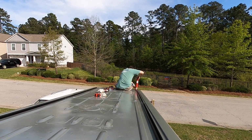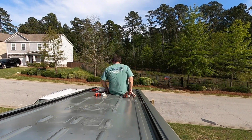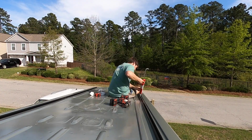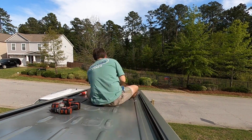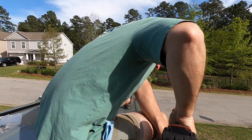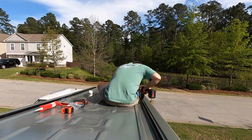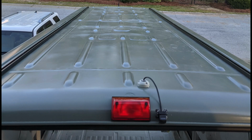So the roof track system is one of those things we had to get in before we spray foamed, because I didn't want to make any roof penetrations after we spray foamed. The only one that we'll do after spray foam is the box to allow our solar panel wiring to pass through, and that's going to be the only roof penetration. That and we'll frame out for the AC unit and the Maxxair fan, but those won't have any spray foam in that cavity, so that won't be as big of an issue there. But basically we got the 4 tracks installed and all lined up, and the backup camera on the van, and it's ready for the next step of the inside of the build, which will be adding some studs onto the walls.